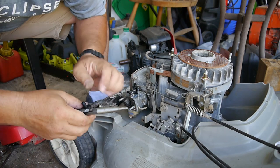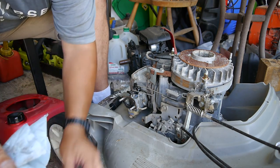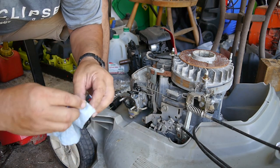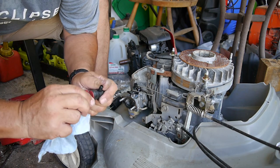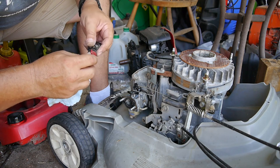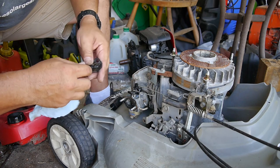Go ahead and take this hose off. Then I can check each individually, see if it's this hose that is clogged or is it the valve. The hose is clear, so it's got to be the valve here. Let's see, so that's off, that's on. I should be able to blow through this. I can blow through it, but it's kind of tough.